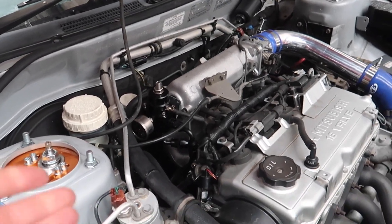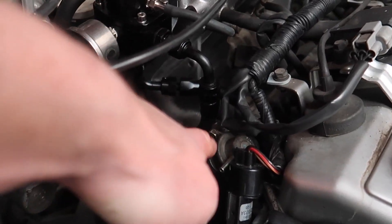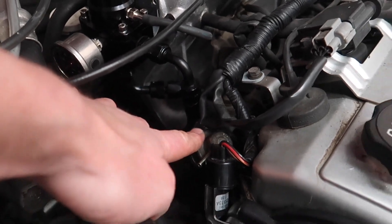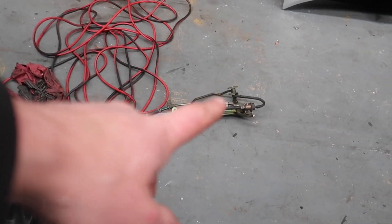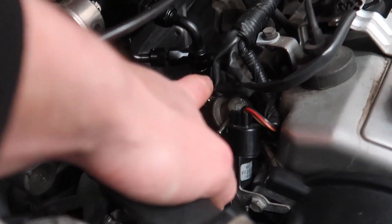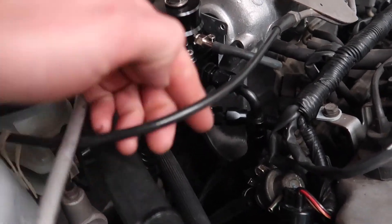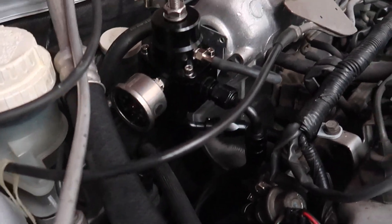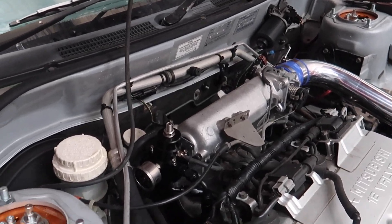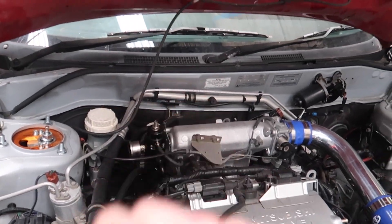You'll be happy to know it's all sorted out - look at that, super tidy! The problem was the fitting at the end of the rail. We got rid of that and instead fitted a fitting off a spare R34 turbo fuel rail that we had. That fuel rail fitting had the exact same fitting that goes into the rail, seals it all up nicely with the rubber o-ring. I just hollowed it out so it's not actually acting as a fuel pressure regulator - it's literally hollow - but it works super well for connecting the hose up to our fuel pressure regulator.